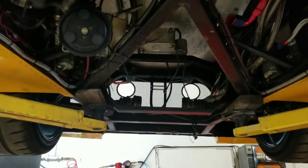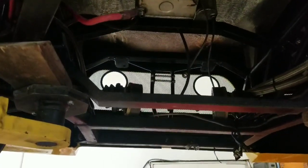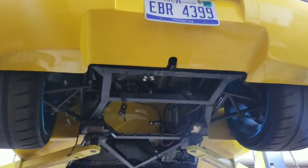We've got the back of the car — the engine's currently out. I suspect that one of the dry sump lines collapsed on the suction side and probably starved the engine oil. It wiped out a bearing at some point when the customer was on the track. Back here you've got dual calipers, one for e-brake, one for primary brake. We're going to have to push the rotor out a bit because the carbon rotors are quite a bit thicker, but there's ample room. It's kind of a diffuser shape built into the body, but it's just a big parachute, so we'll be sealing all that off and doing a proper diffuser.